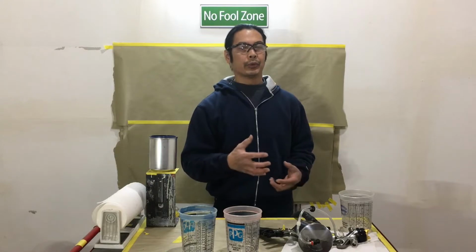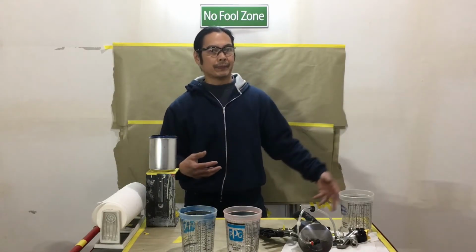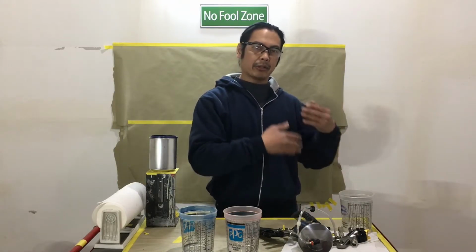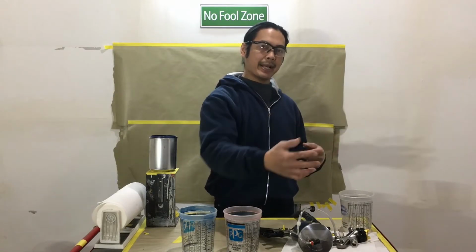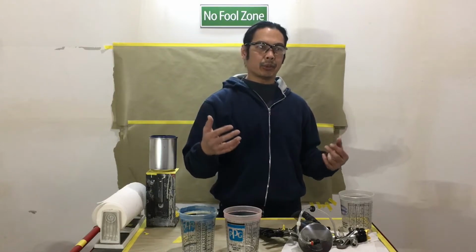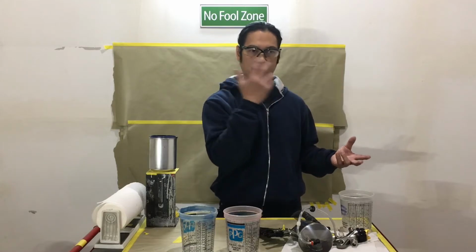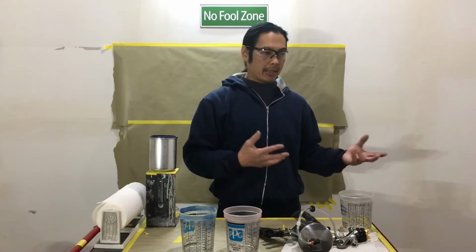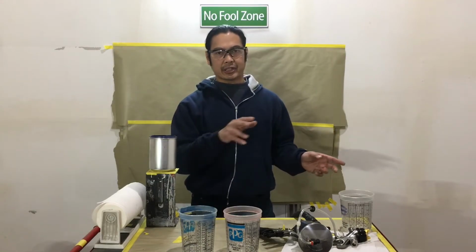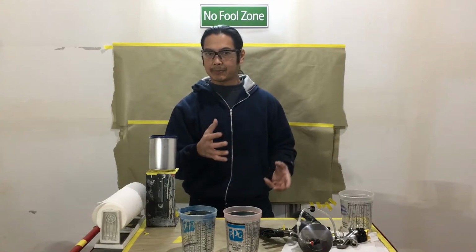So do we really need to get that fast with our paint and our throughput? I think it's better to cycle it through at a much more conventional rate than to try to push it out, bam, bam, bam, bam. And what does that do? It puts the technician at more risk, because the technician's going to run and gun, all right? And it puts the customer at risk too. This is my view, but I've also had this experience, so I know what it's like when people start to have side effects from isocyanate exposure.